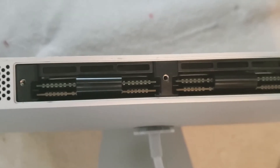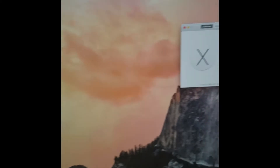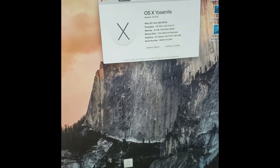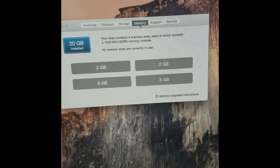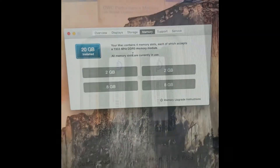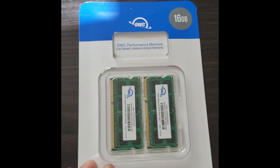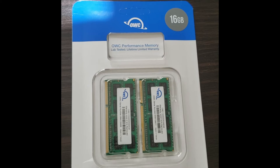We now have both 8GB RAM chips inside, making sure they are firmly clicked in. Fold the flaps up under the other RAM chip, place the plate back on the iMac, and turn on your computer. Go to the Apple icon, click on Memory and look — 20 gigabytes of RAM installed: 8GB, 8GB, and the original 4GB. Now that we see it successfully installed, I'm going to test a couple programs. Then we're going to order two more and see if we can get this up to 32 gigs.